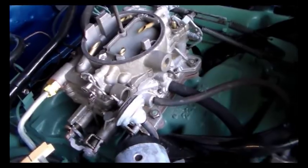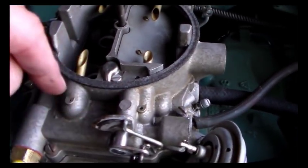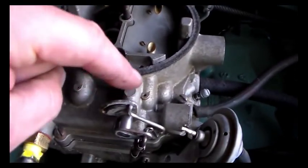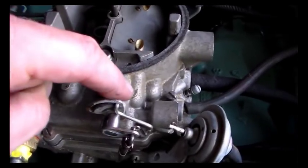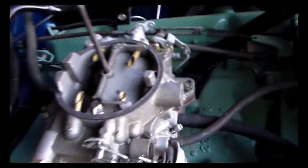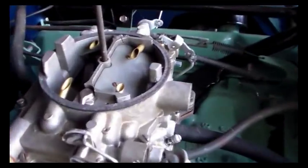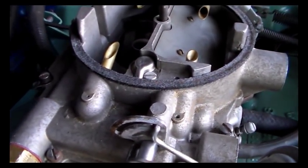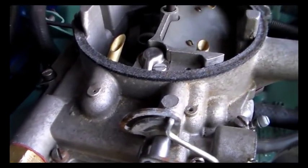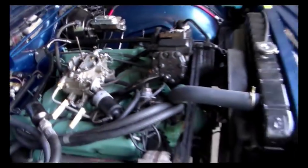I hope it works. I want to show you something real quick. I think Howard also explained this, or maybe he didn't, but he was talking about his carburetor, his Rochester. This is not a Rochester, this is a Carter. But you notice we've got 4 vent tubes, and these go right into where the float bowls are. Float bowls are on either side here, and you notice they have these little holes in them that go directly into that passage. Do you know why that is? Well, I'll tell you why that is. That is really an air bleed for those, because that is to prevent them from creating a siphon. In other words, if there's a low pressure area at the ends of those, if that was not there, then it could create a vacuum type of a deal, and it could start pulling fuel out of the float bowls.